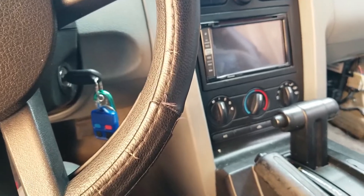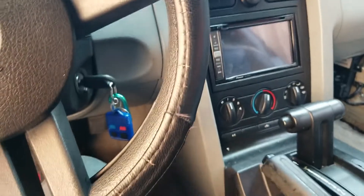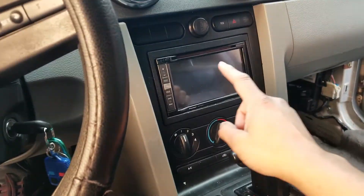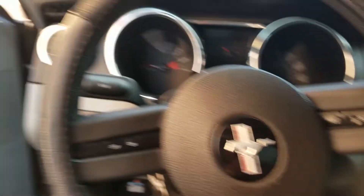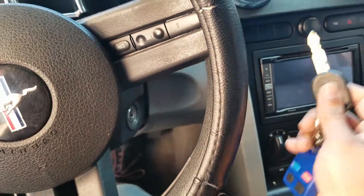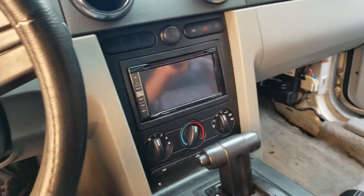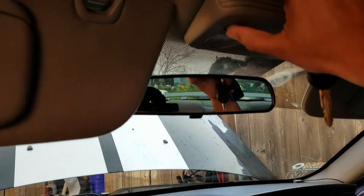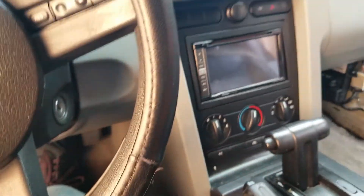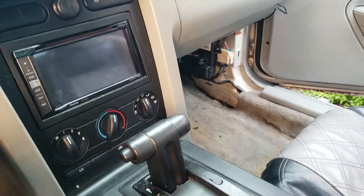The first symptom — this was two years ago — is where everything stays on: your stereo stays on, your lights stay on, power windows will be able to open and close whether or not the key is in the ignition or not. The car could be off, you could be outside doing your shopping, and everything interior will stay on. That is one way of telling whether the junction box is bad.